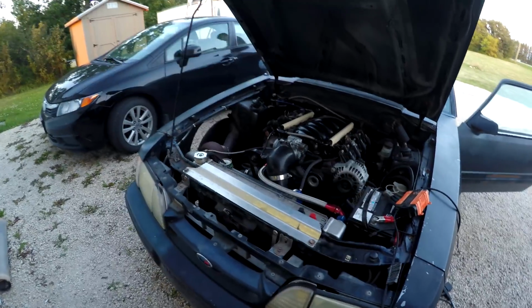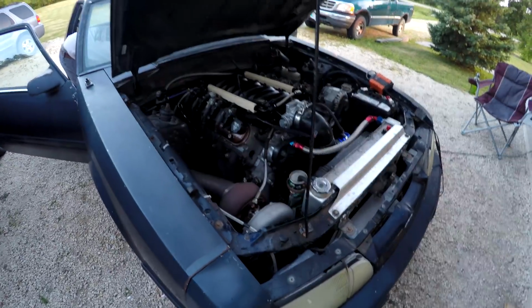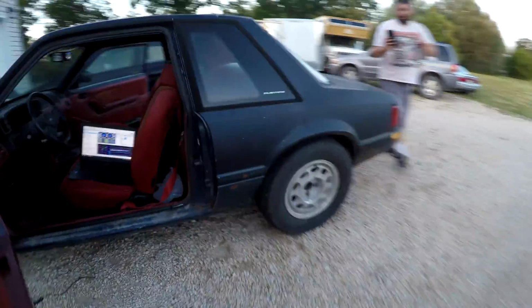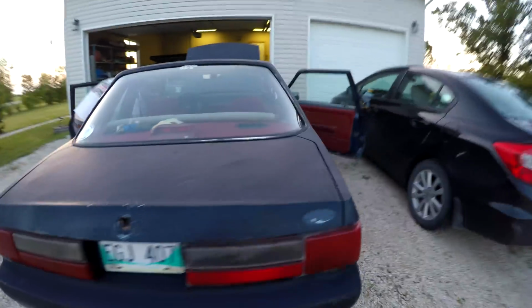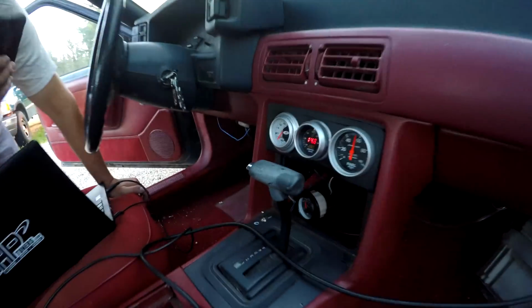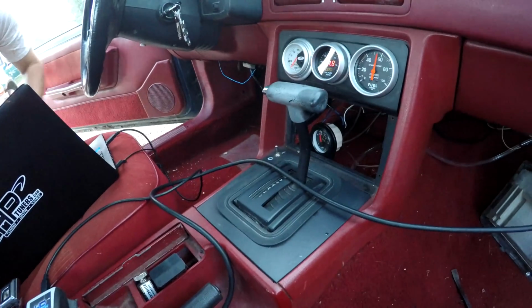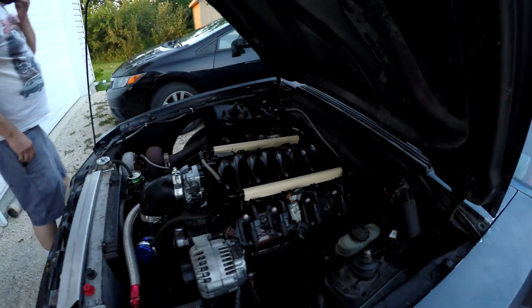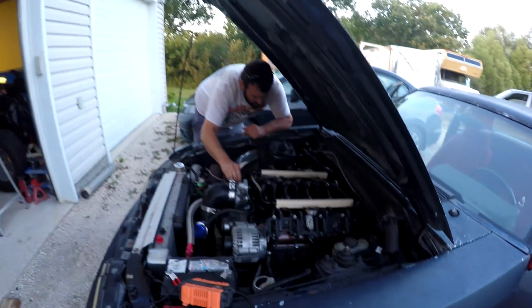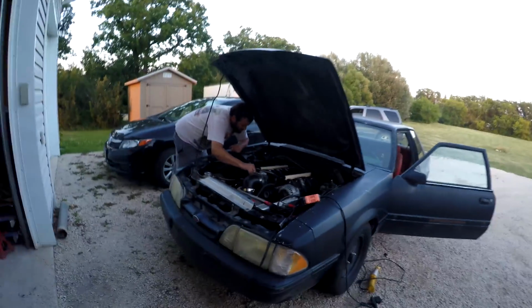Damn, guys. You kind of just missed the first start up there, but she just fired right up. I'm just kidding. I had to start it a couple times, but wow, this thing sounds sick. I mean, we just heard Rob's truck, so we should know, but... 14.8 air fuel ratio. Why is the oil pressure still only at 25? Like, I wonder if this gauge is messed up. It is a very cheap gauge. No clacking. I'm super surprised it's keeping itself running right now. Like with the cam, I didn't change anything for the sloppy stage 2 cam. It's back, boys and girls.